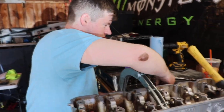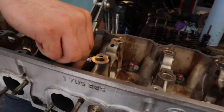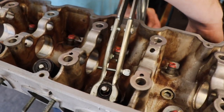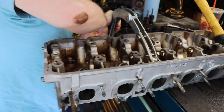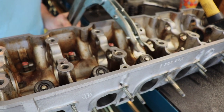Now you take your valve stem spring retainer — I guess that's what we'll call it — and it goes right in the grooves above the valve. I like to leave a thin coating of oil on it so it gives it a suction effect and they won't fall off. Just like that, they're on there. Now slowly release the pressure and you have just installed a valve.